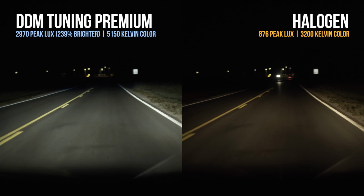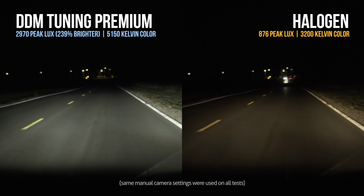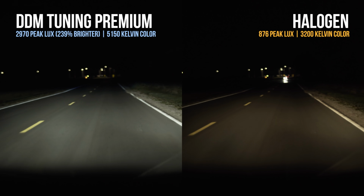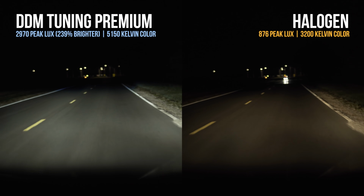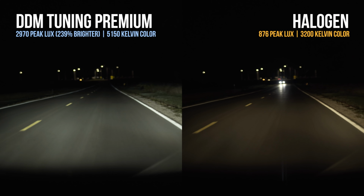This kit was 239% brighter over halogen. We tested it at 2970 peak lux, whereas with halogen you're going to get about 876 peak lux, and that's almost 3.5 times more light on the road. The overall light spread too, as you can see, is much improved. Not only do you get a much further distance, but you get better lighting side to side.